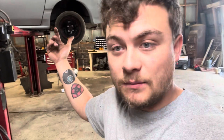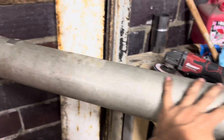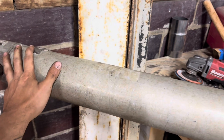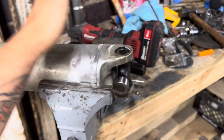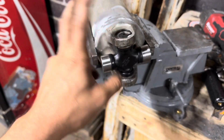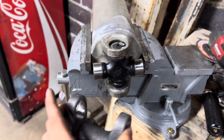I had to put the rear flange back into the diff — it was leaking on my floor every time I pushed the car around. Got that done, and I decided I'd just as well get these u-joints in the drive shaft. We have an Express Van 3500 drive shaft — or a full-size pickup shaft — and it is a 1350 u-joint, which is what this flange is that I bought, so I can put these two together.